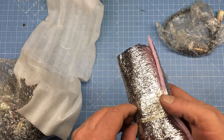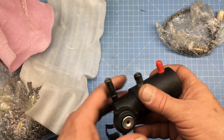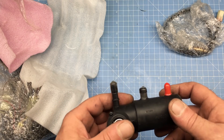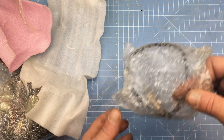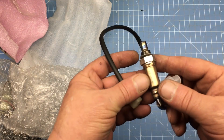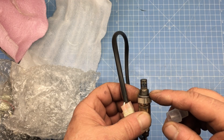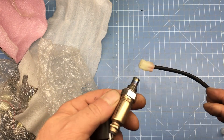This looks like one of those sandwiches you get off the Roach Coach. Oh, it's the fuel pump. The good news is it's a very small package, but it also looks like the fuel pressure regulator is an integral part of the pump, which may give us some problems with the turbo. I'm sort of thinking of running four to five pounds of boost to start with, and we might get away with it. Now, this thing's a tiny oxygen sensor, also known as an O2 sensor. This is interesting — it's also a heated O2 sensor. This is most likely what they call a narrow band sensor, and it doesn't have the resolution that we're going to need. Normally, we would want to use a wide band sensor to monitor the air-fuel ratio. Not to worry — I do have a wide band sensor in my bag of tricks. I just need to make sure the software will let us use something like that, and we'll get into that soon enough.